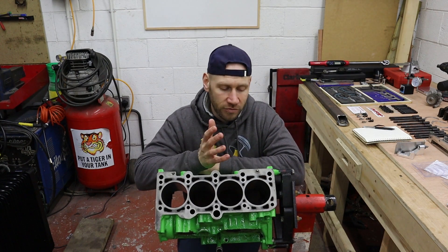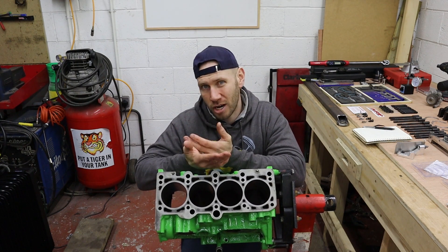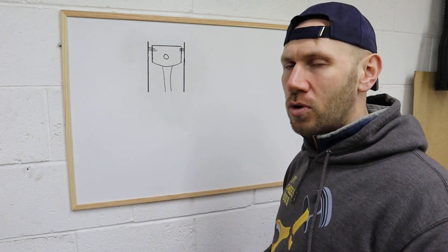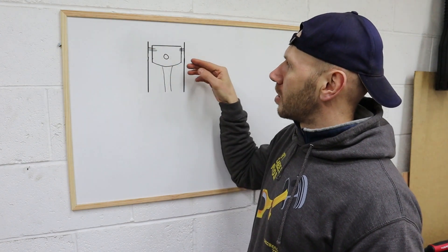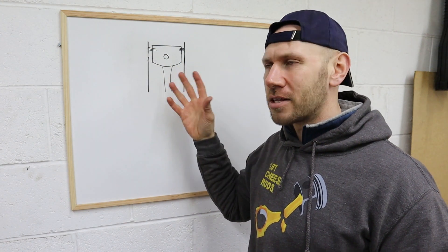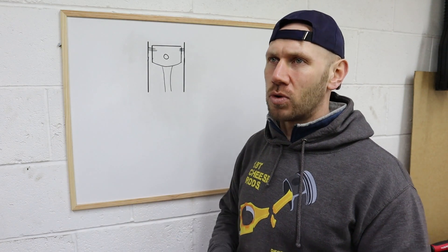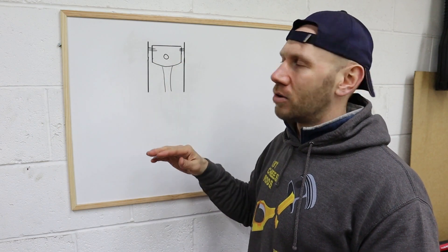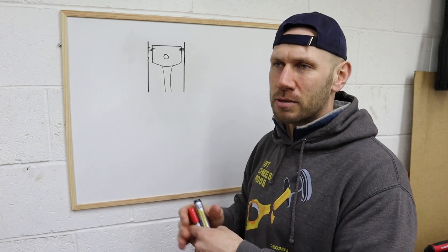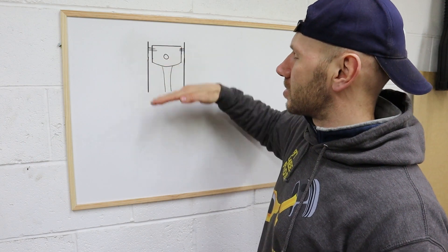Things I'm going to be doing in this video: I need to check the piston-to-wall clearance. They've bored it out to the spec I gave them, but I now need to check that — only a fool wouldn't. So let's talk piston-to-wall clearance. You've got your cylinder walls, your piston, your rod, and your piston rings. Those rings are the only part of the piston assembly that should actually make contact with the cylinder walls. For them to be seated onto the cylinder walls properly, the piston needs to be completely stable. If the piston can wobble around, the rings will become unseated or unstable themselves.